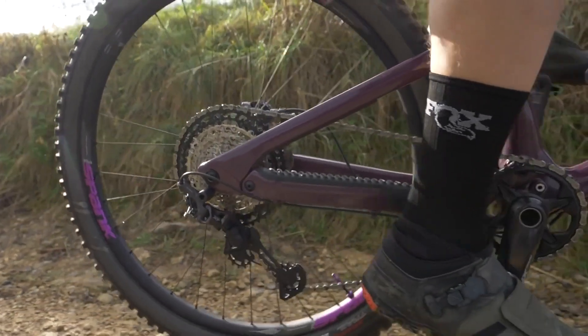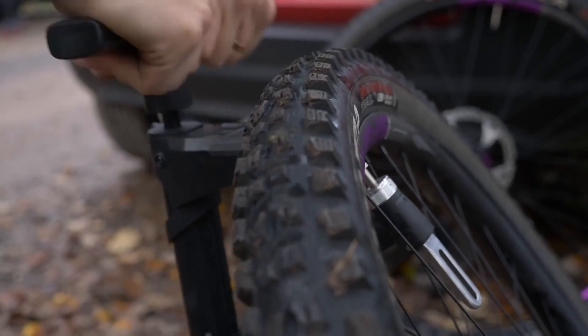But with the rear, if you go really low it's going to be so draggy, especially in the summer — don't do that to yourself. I'd probably run the rear as hard as you can stand. And then the front, I would just experiment with as low as you can go before you start to hit the rims. I'm afraid there's no calculation you can do and no set answer here, but I would maybe start in the middle of what your range is recommending. If it feels too harsh, drop it a little bit — maybe two to four PSI at a time. If it doesn't feel harsh, just keep going because it's going to be a lot faster and less draggy anyway.